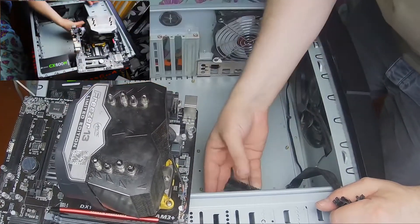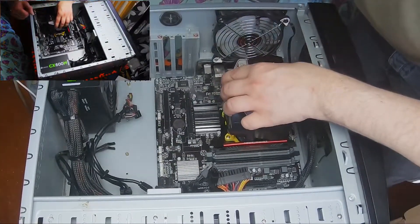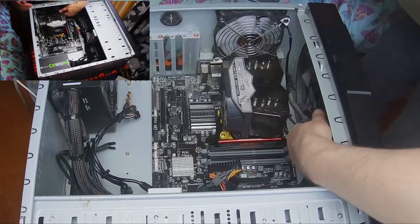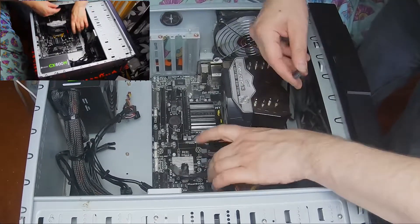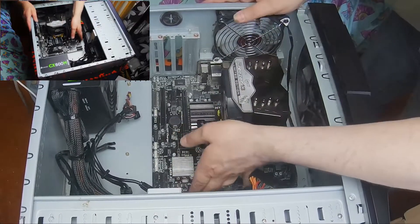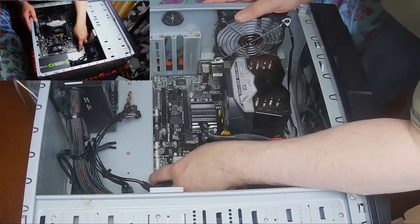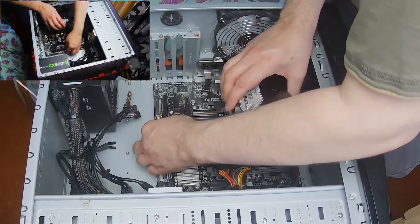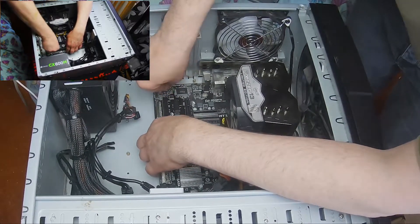All we do is reverse the scenario of what we just done — this can be the tricky bit. It's not normally slotting in nicely because remember I put the back plate in. We nearly had a problem there — the lead for the rear case fan actually went underneath the motherboard as I was trying to place it in. Hence why you don't screw it down straight away — you leave a space. And I've just noticed this has two extra holes here and here, so I've got to remove this slightly and move that. Sorry if my head's getting in the way.